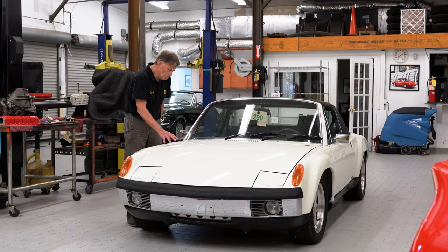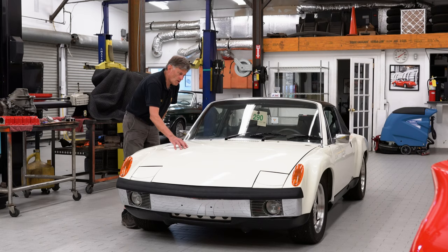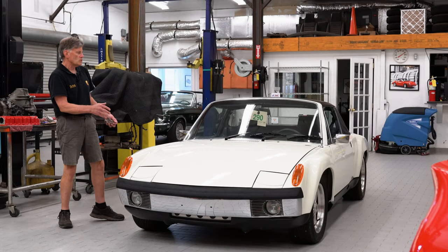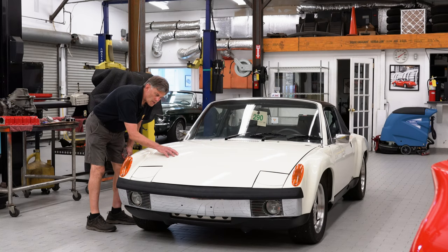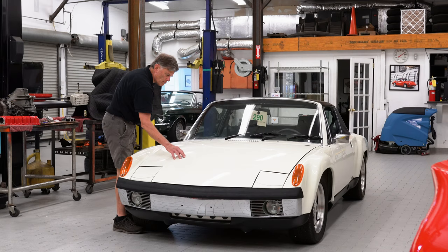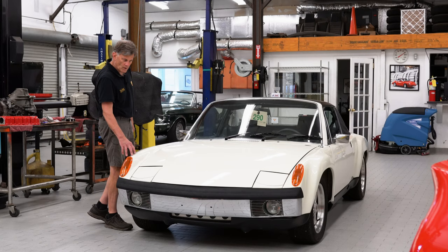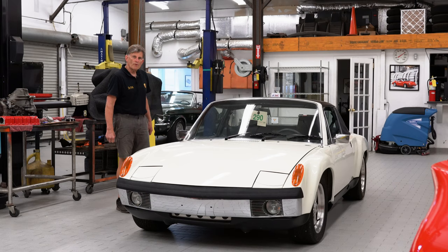They spent a lot of money. One thing I can see which is not so good is that the paint has had a reaction and it's got some pimpling. It looks like this car would need to be sanded and buffed because the resins in the primer have come through. Although it looks really great from a distance — flawless — when I get up close and look sideways I can see some little pimpling. We don't know whether that can be sanded out or not. If not, the top surfaces will certainly have to be repainted. But still, the car looks great and it's the kind of car you can drive, not worry about getting a nick in, and have a tremendous performer that still looks good at a local car show.